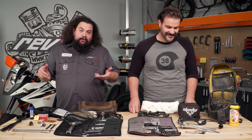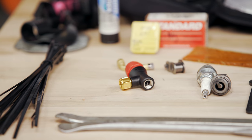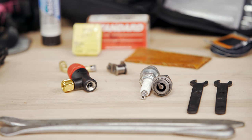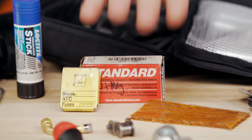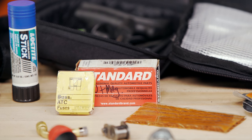In my old Harley kit, what I'm trying to do is keep them running and keep them on the road. So I have things to help prevent against mechanical breakdowns. I have a set of spark plugs that fit flatheads, knuckleheads, and panheads — so even if I don't need them, a buddy might get out of hock if I have a set in there. Another fairly universal item among me and my riding buddies are spare points and condenser for a magneto. A lot of us run mag-fired bikes, and it can be helpful to have those parts in somebody's tool roll when we're out for a ride.